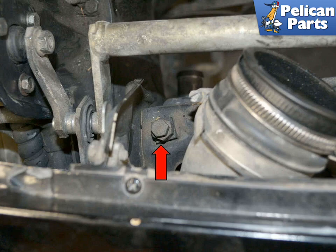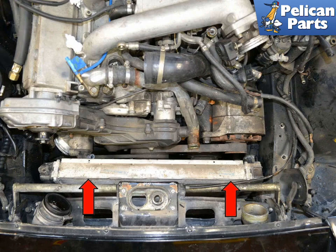There are two jam nuts on the top of the radiator, one on each side at each corner, indicated by the red arrows. Use a 10mm socket with an extension and fully loosen the nuts on each side. Tilt the radiator back towards the engine, as indicated by the red arrow. You may need to gently wiggle it around to free it from any debris that may be holding it in place.